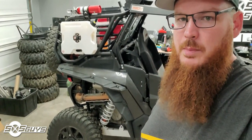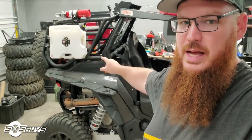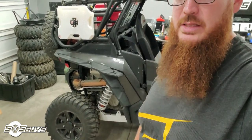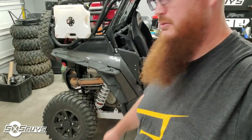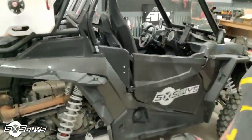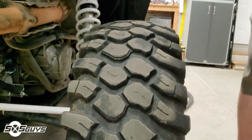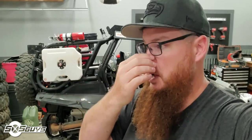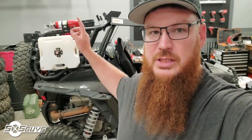We have pretty solidified a sponsor to run new tires and rims on the car. Back there you have the Big Horns that come stock on the Razors — those are 29s. We actually ended up running the trip on these original Polaris 14s with these 28s from Discount Tire. They're very much a square profile, and what ends up happening is that when you're taking corners at speed, eventually you'll roll that corner and it feels like it's throwing you over. That is not preferable and it's uncomfortable, so we can't wait to bring our new partner on board — probably next week.